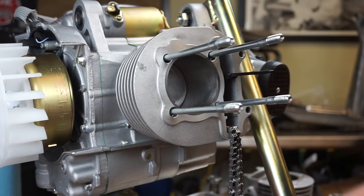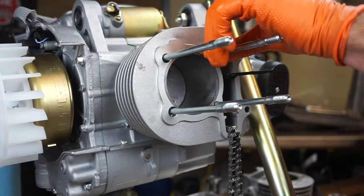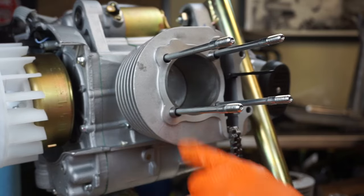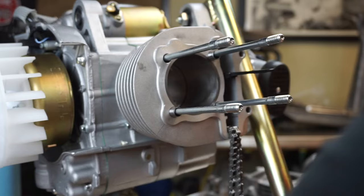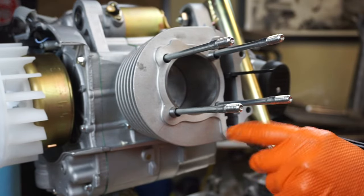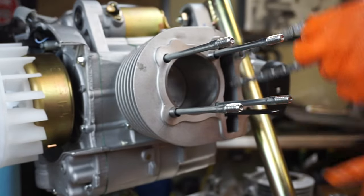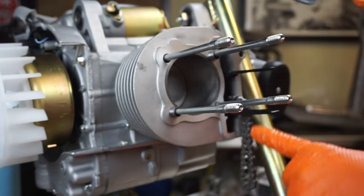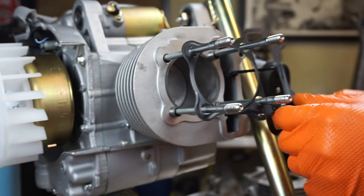Now pull the timing chain out and apply pressure — make sure the piston slides inside nice and easy with no binding. Install the top dowel pins; they only go in one way, so it's obvious where they go. Before installing the head gasket, deal with the timing chain guide: pull it up out of the way — there's a little notch cut for it right here. The head gasket has a little area that holds that piece in. Slide it down nice and easy with no binding.